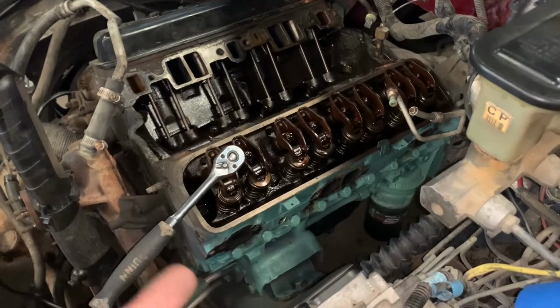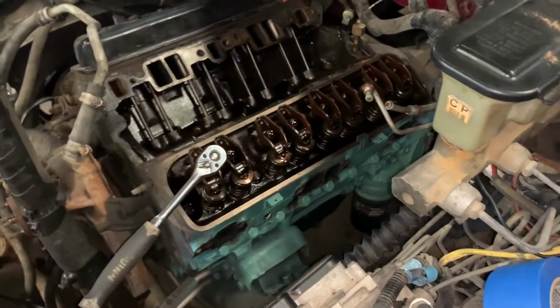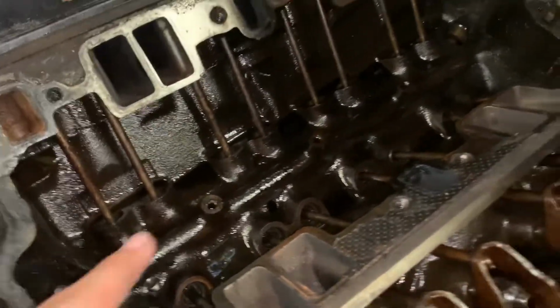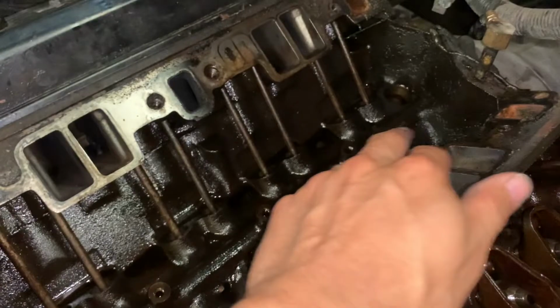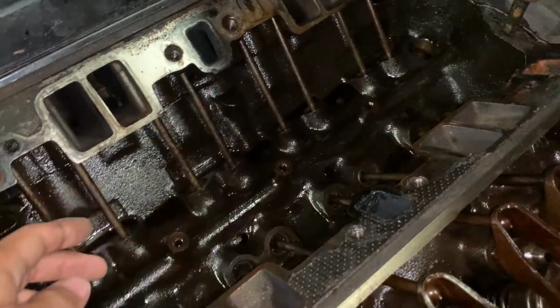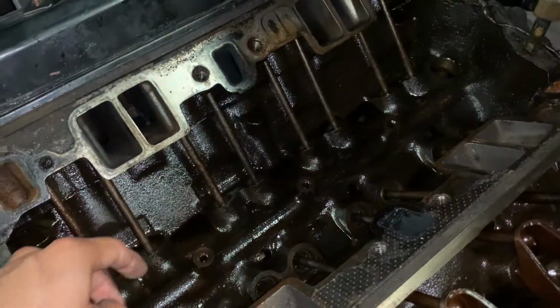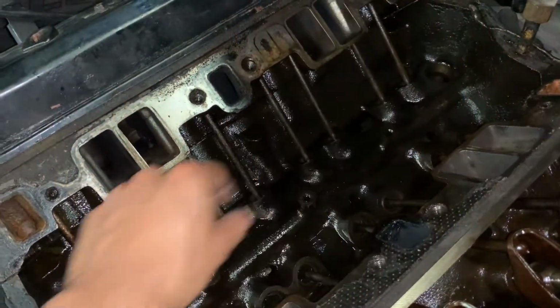But like I said, the heads on that truck are still good. Anything really would be good, just the block isn't. So any of the pushrods, lifters, whatever. And I don't know if I mentioned this, but this one has the Vortec style for a roller. See, it's even threaded. I made sure it's threaded. On Project Sandy, it doesn't have these towers. It's just straight Vortec.